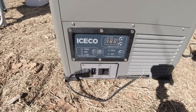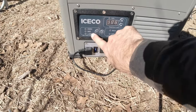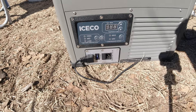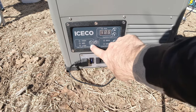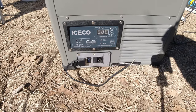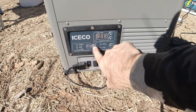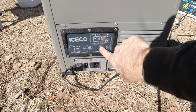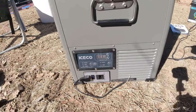The screen says 39 degrees right now though it's really bright out so you can barely see it. You can set your battery protection level — it's got battery protection built in, which is really cool. If your battery gets too low, it just shuts itself off. That's dangerous for food but at least it's not going to kill your battery. You've got high, mid, and low settings for battery protection. You can turn the fridge off and on here — you can leave it plugged in and turn it off as you want. My other fridge, my Snowmaster, once you plug it in it's on — there's no on/off button. So that's a nifty difference. I can set the maximum and minimum temperature here with the compressor speed, and it tells me if it's running and shows the readout.